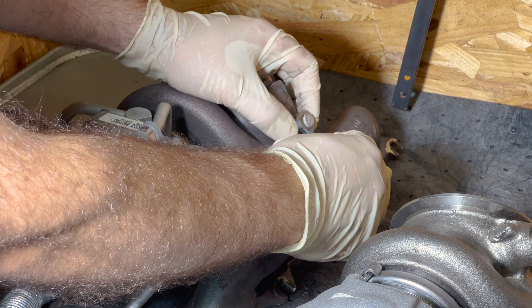Got a T30 here for the coolant lines and another one for a clamp. Give it a little wiggle back and forth. For the coolant feed line from the engine, I had to tweak this a little bit to be able to get this section to clear the larger inlet — I basically put this on my shelf and torqued it so this is more straight, to be able to line up the one hole using some coolant for lubrication on the O-ring. Now you're going to use one of the supplied lines for the turbo return to the block. Bringing over the oil drain line. Next up we have the banjo fitting for the oil supply line. The drain already had a whole bunch of oil on it — it's been pre-lubricated. Since it's dual ceramic ball bearing you don't have to worry as much, but I'm going to put turbo additive just for peace of mind so it won't be a dry start. Bring over the oil feed line — make sure you have one copper washer above and one washer below. Keep it at a 90-degree angle, decently snug, just enough to compress the crush washers. That was 16 mil.